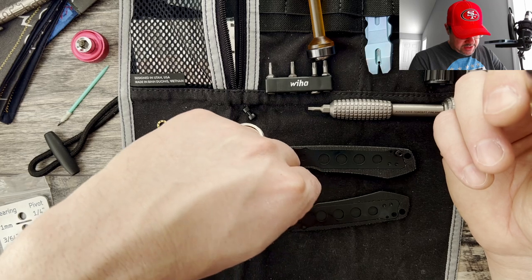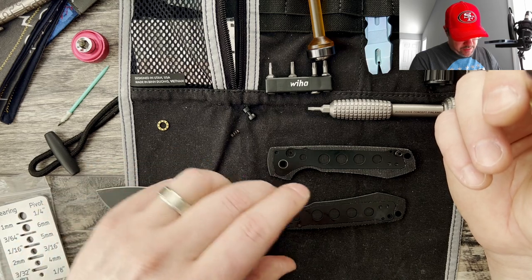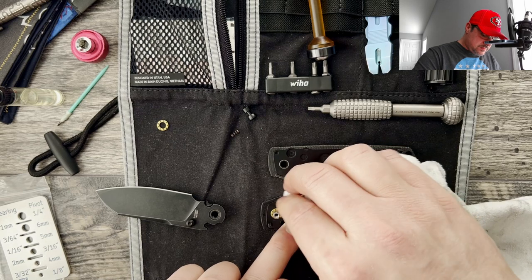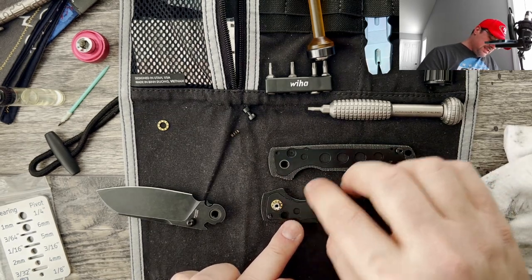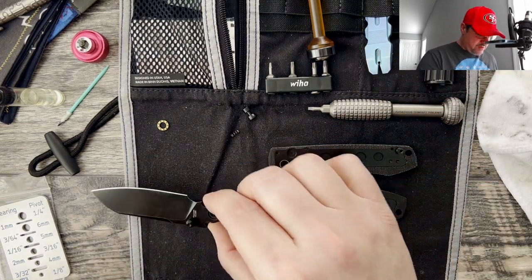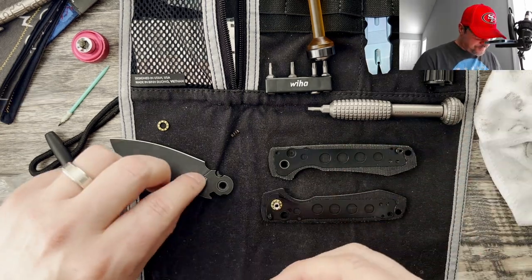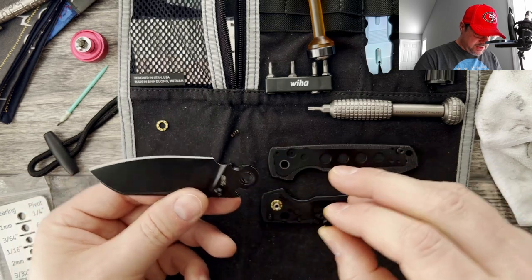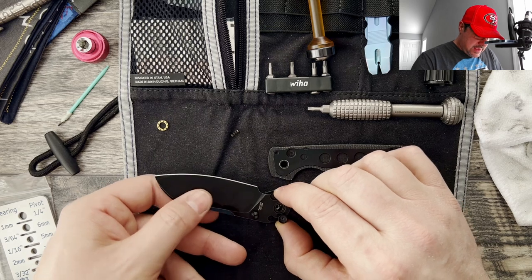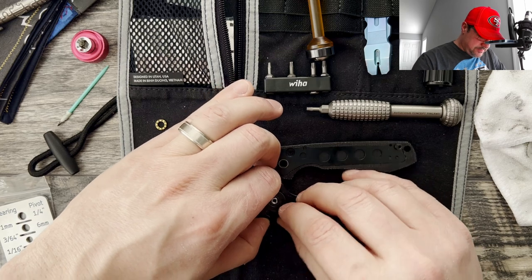But when we opened this up, if you recall a moment ago, I forgot to point it out, the open side, which is how I was able to immediately tell that these were stamped and not caged bearings, was facing outward. And I think it just helps create a little bit of a seal. But with stamped bearings, you're going to run the risk of those potentially catching dirt anyway. What I recommend that you do at this point for the reinstall is just press it against the blade, and then go ahead and drop that with the lock on into place.